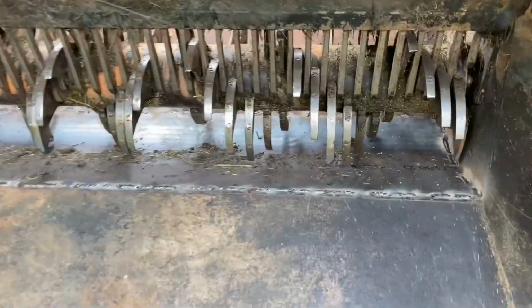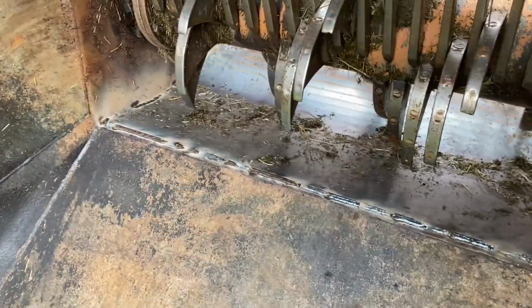So we got her put back together. Wayne welded it all up. Nice weld across the back here. Welded along the sides and then in the front as well. Just tacked together up there. Stitch welded. And we used a jack to kind of push everything down so it was really good and tight.